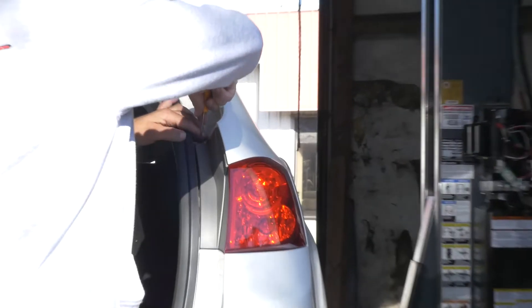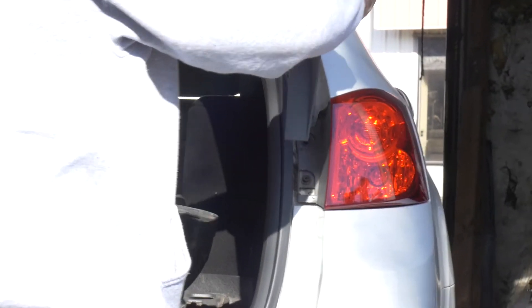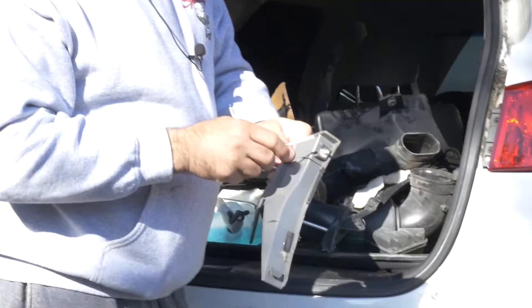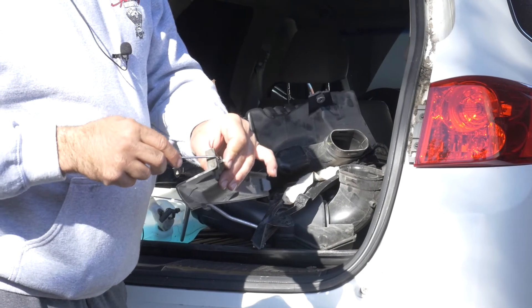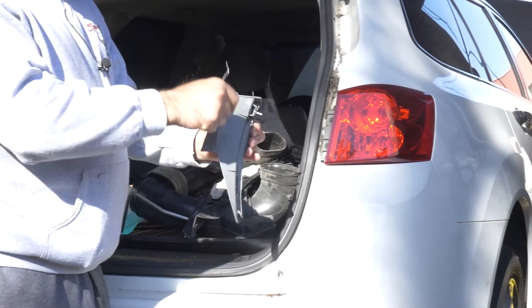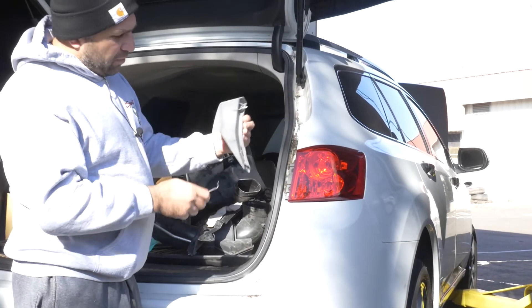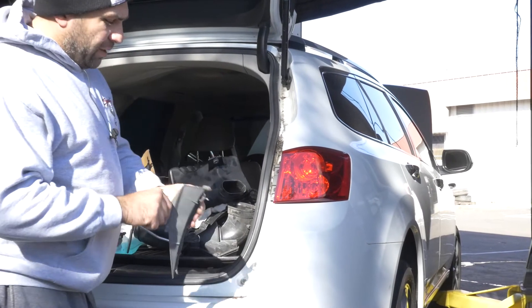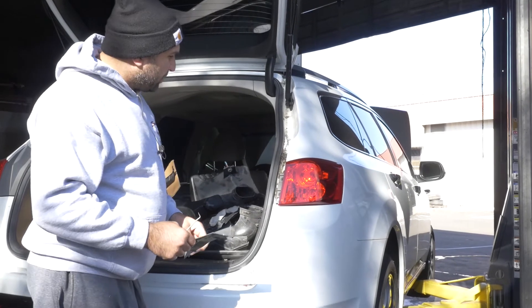I'm gonna put this pick back here. You've got to pull it forward and then slide upwards. If you can see this tab right here — I just put it there and pulled on it, pull this tab out. If you peel this way you'll snap these clips. You've got to pull like this and then slide upwards because it has a tab that slides into here. You don't want to snap the taillight. You can see all the crud in there.